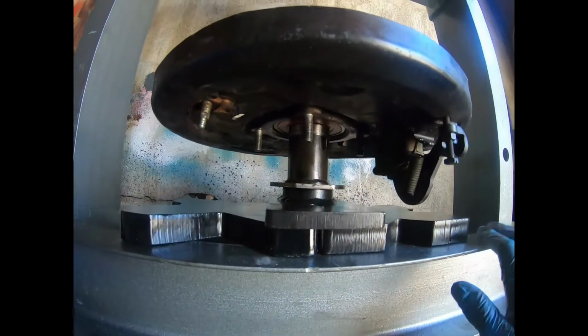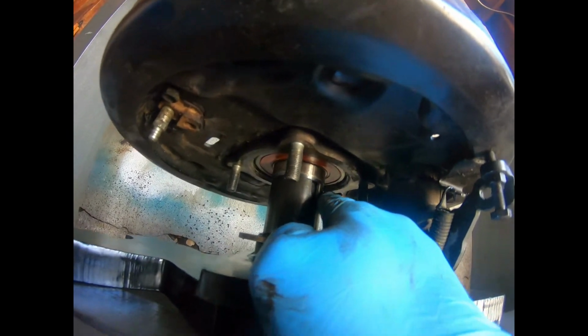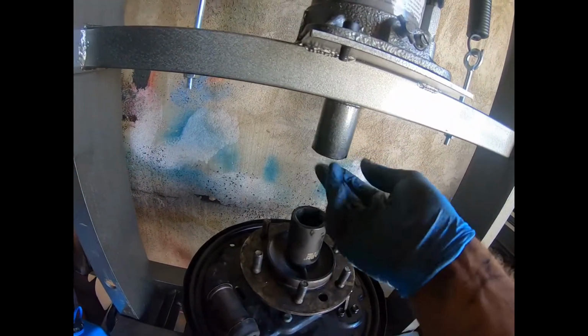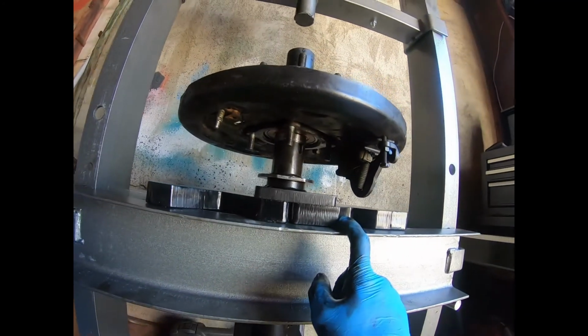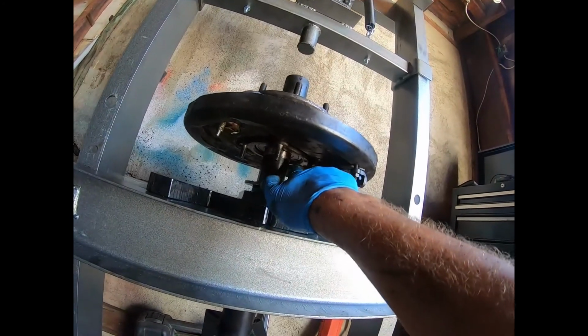And so what we got here, retaining ring is up. You can see through here through this tool that this guy made, which is awesome. You can see that it clears the gap for the C-clip. Bearing is pressed all the way in, and I used an axle socket on top of this little hub thing, and pushed the jack down into that. Cranked it, had to undo it, look at it, and bearing wasn't flush, it wasn't seated properly, and tried it again, it went right in.